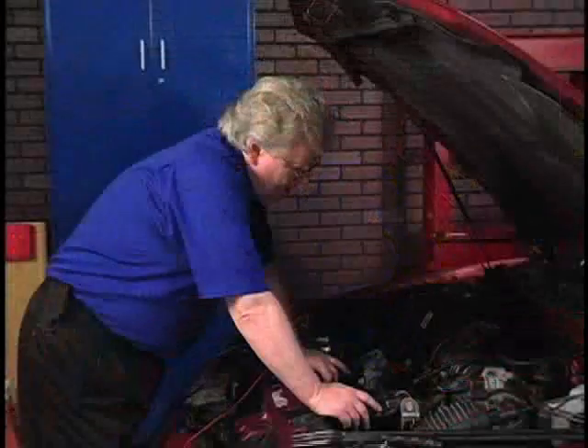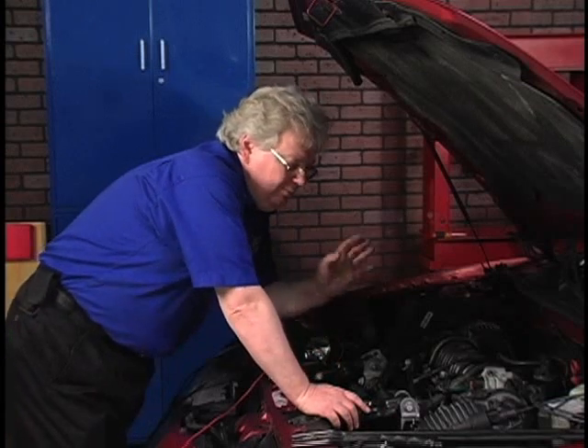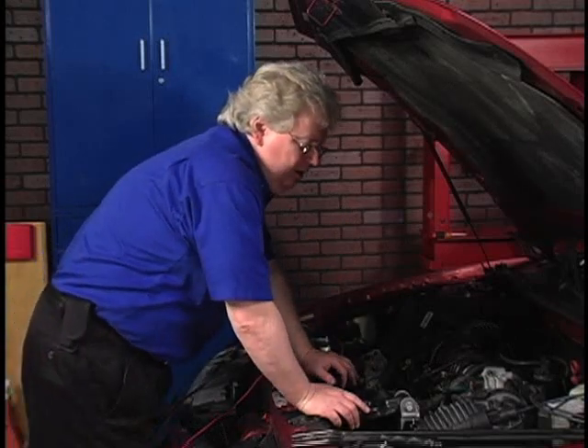Now I've got a 1998 Olds 3800. We're going to use the smoke tester to locate vacuum leaks fast. Let's talk about what kind of prep we've got to do to get this smoke machine to roll some smoke through this intake manifold and check for vacuum leaks. Looking for drivability problems, want to check for vacuum leaks, let's go for it.